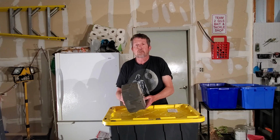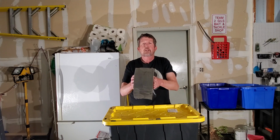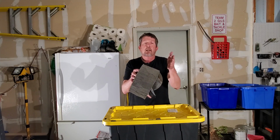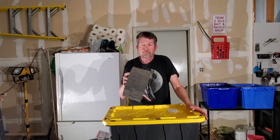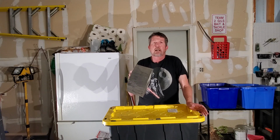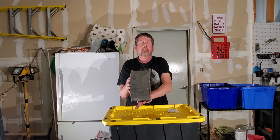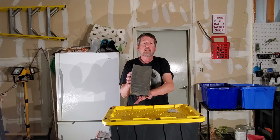Camber is the tilt of your wheel. So if this is a front wheel here, if it's positive camber and I'm facing forward to you, the wheel is like this: the bottom of the wheel's in, the top of the wheel's out. You want negative camber, the top is in, the bottom is out. What that does is when you go around a corner, your suspension flexes and your tire flexes. When you go around the corners really hard, you want your tire to be flat. So like on woods racing, what I do typically, or even motocross, that's typically negative camber.